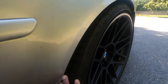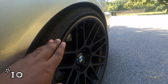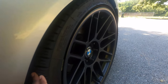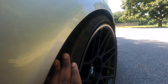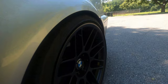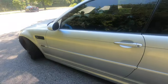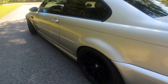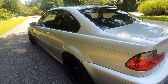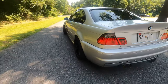Because, as you can see, although I already rolled these fenders off camera in the past, they still rub because I just like wider wheels. These are 10.5-inch wide on the back, and 10.5 is wide for an E46 M3. Although I'm still running 275 right now, you can see the tire is stretching. I don't like stretched tires, that's why I want fat tires. That's why I want to go with 275-35 because I feel like it's not going to stretch as much. 285 will also work, but with the power this car is really running, you don't need 285 — I'm not really fighting for grip even at 275. Although I do not personally like these tires, I want to change them for a more summer tire. This is kind of like an all-season tire — it's great, but it doesn't stick as much as I prefer.